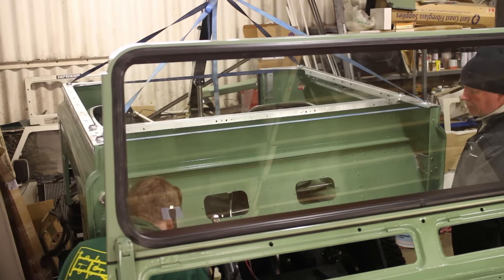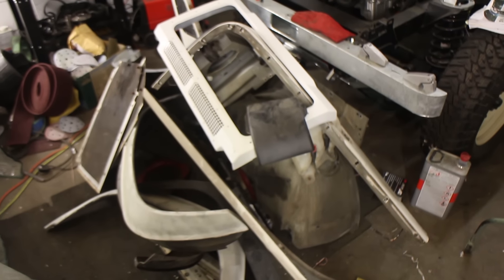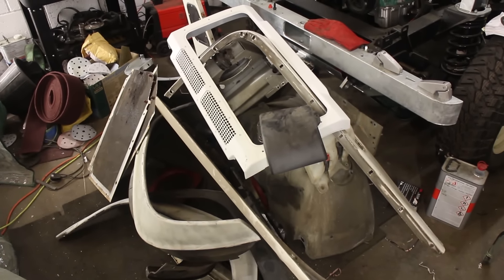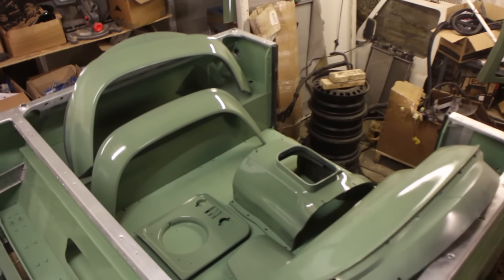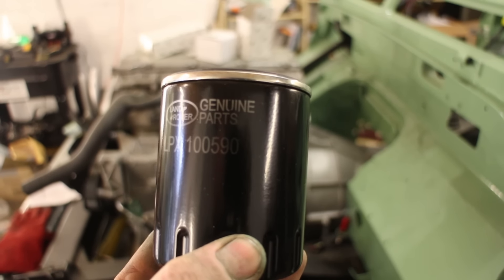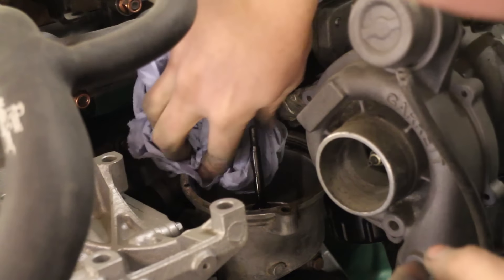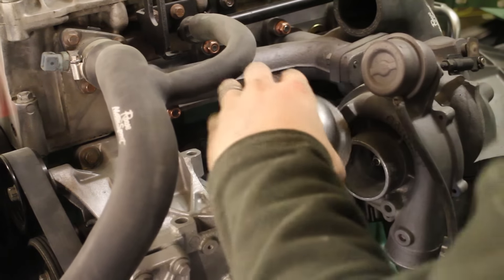I've rigged up the engine crane onto the rear tub to lift it and access the fuel tank, fuel pump, and electrical connectors underneath. Here's a pile of parts still to paint, and here are some I've already prepared — all painted in the same pastel green, using a plastic primer on those. I'm also fitting genuine filters: an oil filter from Land Rover, hand-tightened, and replacing the centrifugal rotor filter in its housing on the TD5. I fit the new o-ring and drop the new rotor filter into place.